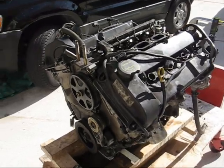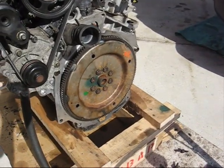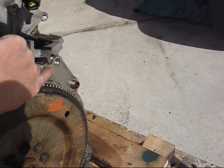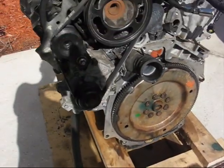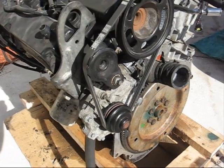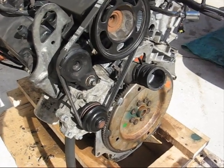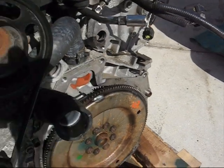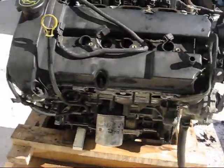The engine is ready to go back in now. A few things I want to mention: we ended up using the Escape flex plate because they are a little bit different from the Taurus — it actually uses different mounting holes. The water pump — we ended up keeping the water pump from the Taurus. Ford actually used the same pump on the Taurus and the Escape, but in April of 2003 they changed the water pump design. It just so happens that the two engines I have here are on opposite sides of the changeover date, and that's the only reason they're different. This one has a smaller tube going into the engine, so I'm keeping this water pump so that all the hoses and everything match up. We're going to go ahead and drop this back in the car now.